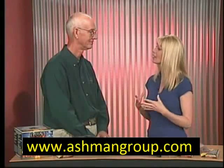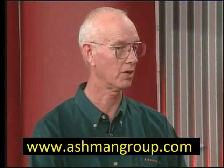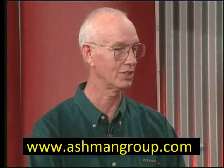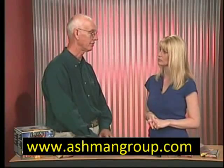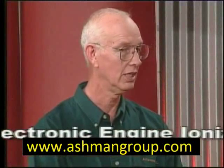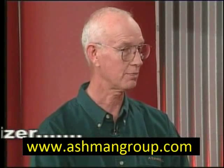Dr. Burr, remind our viewers again just how the Ionizer works. The Electronic Engine Ionizer Fuel Saver is a technically complex but structurally simple, patented and trademarked device that attaches to the spark plug wires of any gasoline-powered spark-ignited engine. When a spark plug fires, the capacitor block attached to each spark plug wire picks up a high-voltage, low-amperage charge — sometimes called a corona charge. This charge is transferred from the firing cylinder to the other non-firing cylinders by a harness wire. This causes a partial breakdown in the large hydrocarbon molecules in the cylinder that's filling with fuel, resulting in increased combustion efficiency. This translates into better fuel mileage, more horsepower, easier starting, and less pollution — lower emissions.